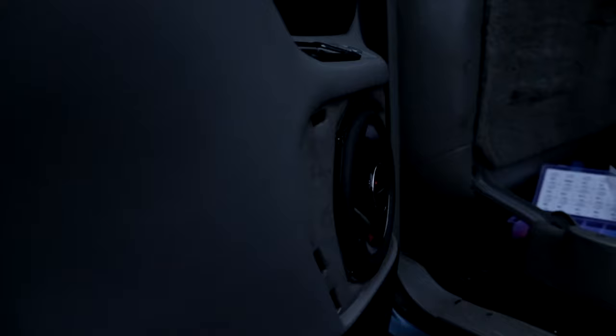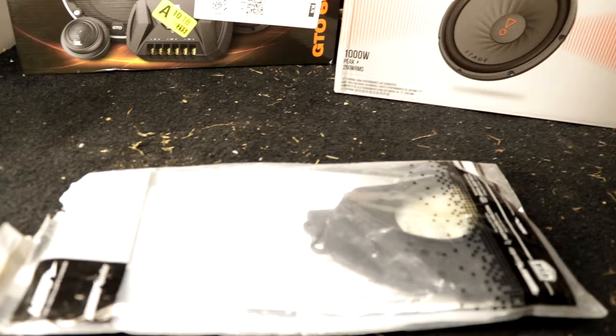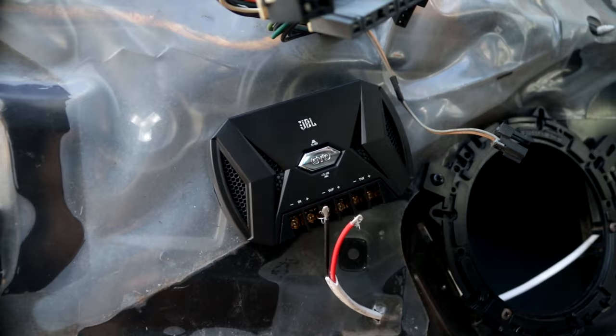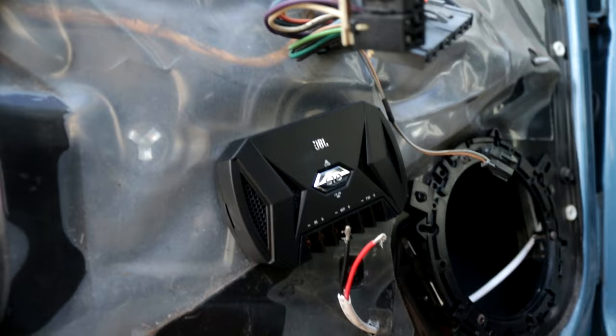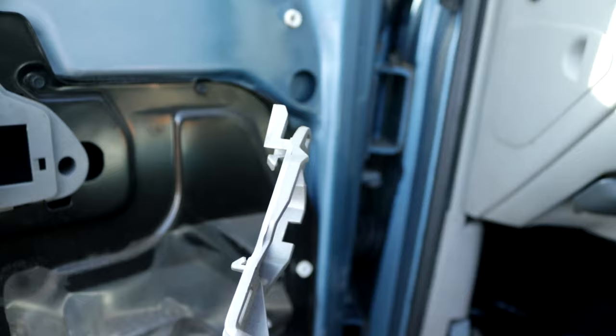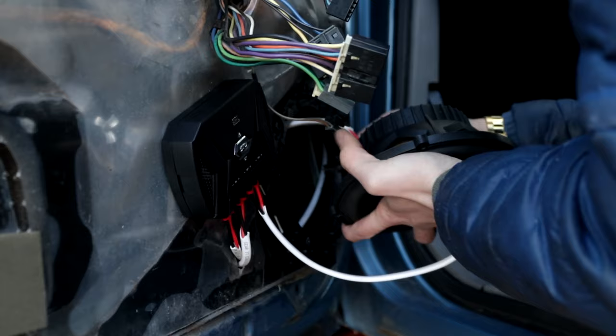Let's start off with the rear door speakers as they're really easy to get to. Pull those out, bolt them in. First one's in, fits pretty good — we'll see if the grill clears. Now the very rear speakers are 4x10 and we're going down to a 4x6 with a Metra adapter kit. Rear roof speakers are in. Let's put the original covers back on and move to the front. Our front door speakers are more complicated since we have to install crossovers and tweeters. Crossover is mounted — watch out where you're drilling because you can drill into the window regulator. We'll attach these two wires and run our tweeter and woofer wire to their locations. Our tweeter mounting spot will need to be modified — this hole is big enough but has a little extra bit on the end that we'll need to cut off so we can fit the tweeter housing and tighten it on the back side.